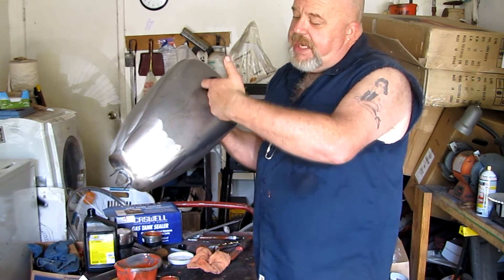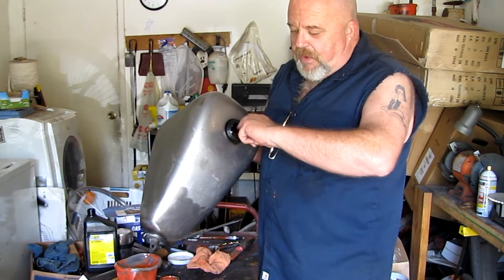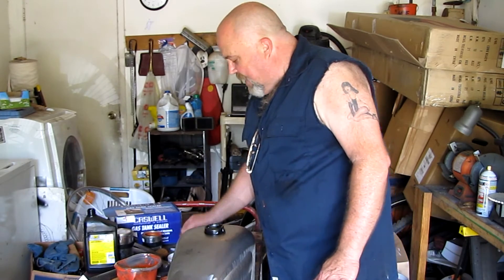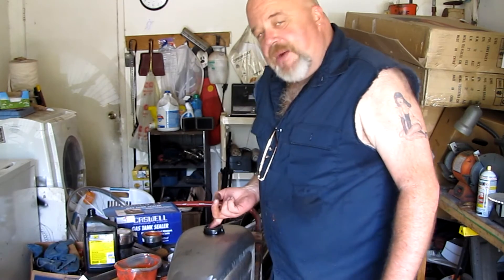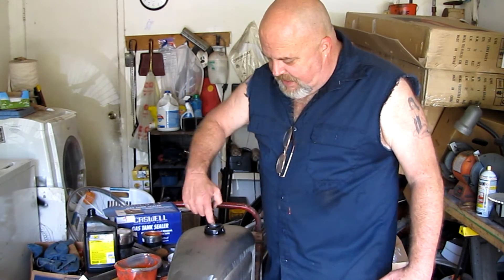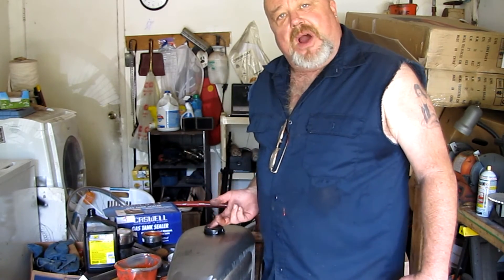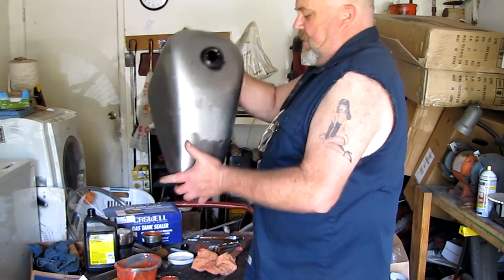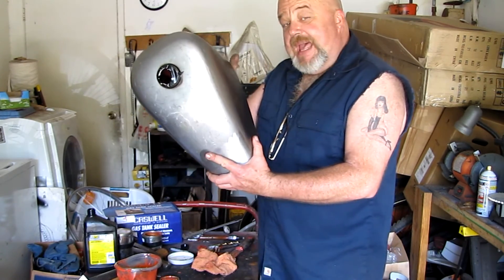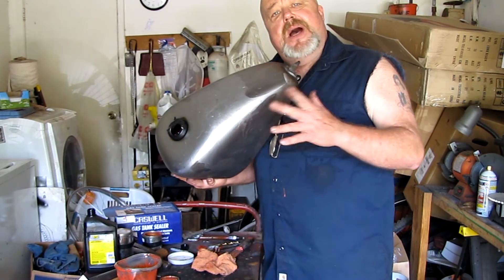I'm going to rotate it once to get a little bit around the neck here where the filler is brazed into the top of the tank. I want to be very careful not to get it inside the threads of the opening. I can also get my finger with a little bit of oil on it and rub it so all the important areas are coated with oil and the epoxy won't stick. After a little while you're going to feel the tank starting to get warm - very warm. That's your cue to know that it's working and starting to set. If you like my video, give me a thumbs up and click subscribe. Thanks for watching.